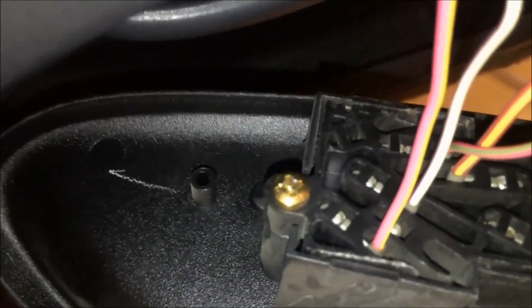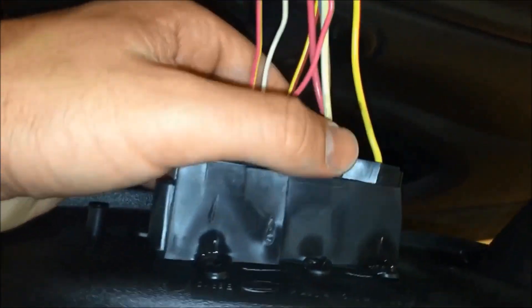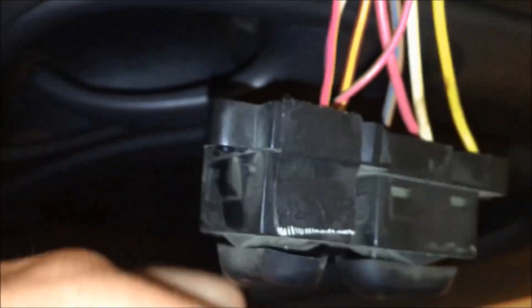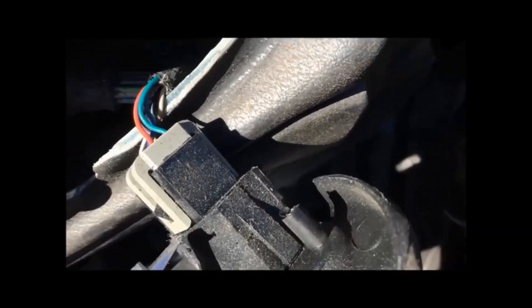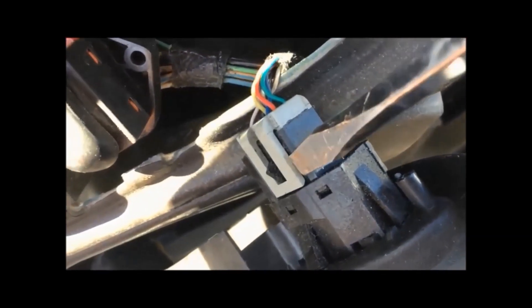On the back side there are two more Phillips screws, one on each side. That will allow the wiring to stay in place and separate this door bezel. With those Phillips screws removed, just slide this whole harness out — buttons and everything stay there. Once the switches are detached, there's the mirror control here. Put a screwdriver under it, lift up, remove it, pull the plug off, and set your door pull aside.